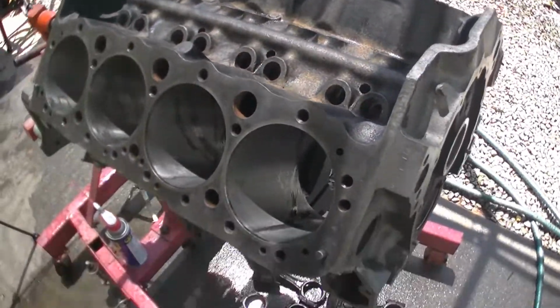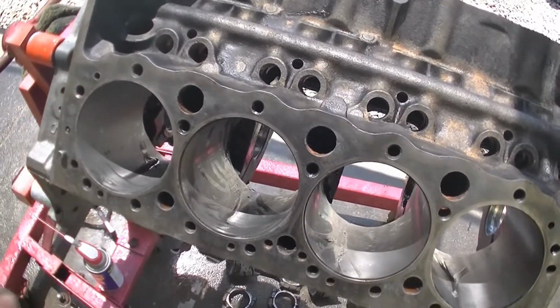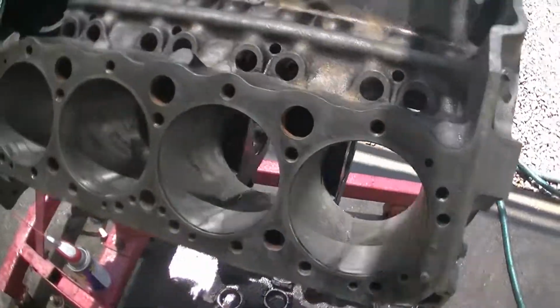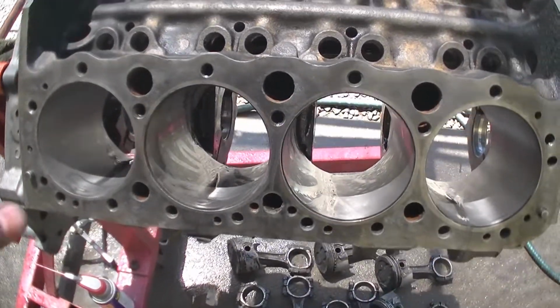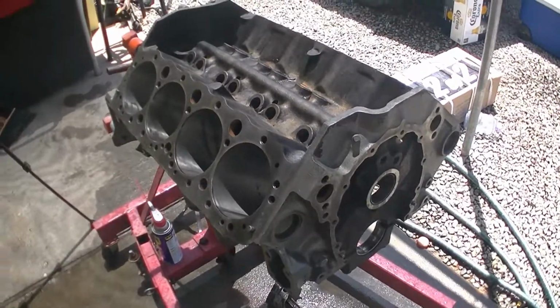So, that's it. That's how you hone the block. Just go fast, 20, 30 seconds. Go to the other one, 20, 30 seconds. Do that all around. I like to do about 2 passes. Clean them up, that way it's all nice and clean. So, yeah, stay tuned for the next video.